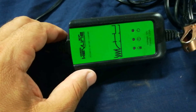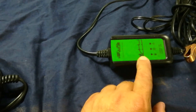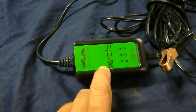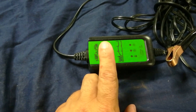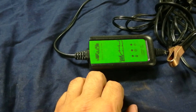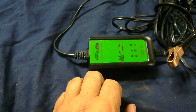If you had a battery that was dead for a long time, I'm going to include this too — this is a battery desulfator. You can use this instead of the battery tender; it's a lot cheaper, but it's only a 1.25 amp charger. If you had a battery that was dead for a long time or you let the car sit, and it's a 12 volt battery, I would highly recommend using this before you replace that battery and waste 100 to 150 bucks. I would definitely try this — the description will be in the link below.